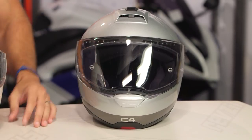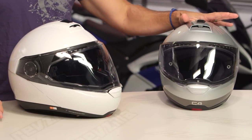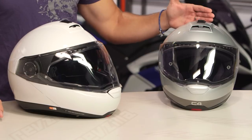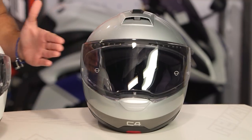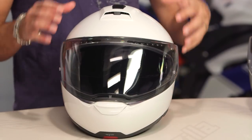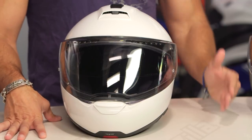Here's where the reshoot happens and why you're watching a different video today. We love the advancement in 90% of what they did with the new Schuberth C4. When we tested it and rode in it, we had our late production sample. We had this bad boy right here, which had this shell shape for not just an extra small and small, but also a medium and large — and that shell size is really three pounds, 12 ounces for DOT and ECE rated. The problem is when final stage testing hit the US and they had to do all the beefed-up requirements to pass the DOT rating here in the States, what ends up happening is for your mediums, large, all the way through XL and 2XL, you have your medium and large in this bigger shell, and you're actually adding four additional ounces.